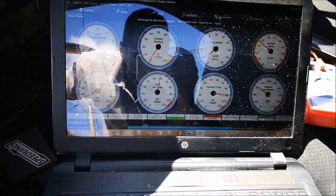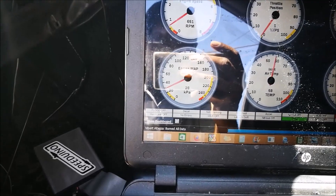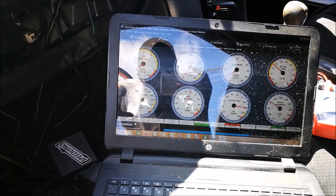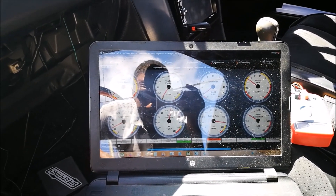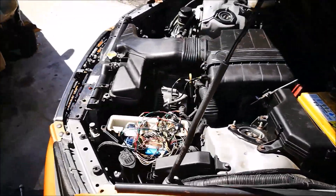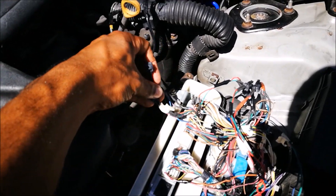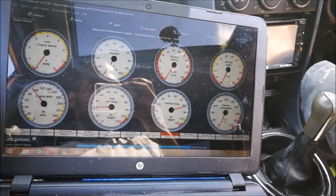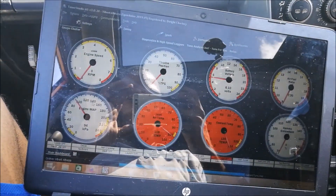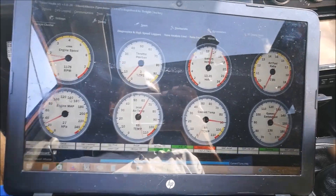With the trigger set, we have minor idle tuning to do — AFR around 12.5, pulling more vacuum than the factory ECU, idling about 600 RPM. We're going to adjust the throttle body to bring idle RPM up a bit and then take it out on the road. It's idling really smooth — really good. Factory ECU disconnected. We're about to take the car out on its maiden voyage to get some fuel and do some initial street tuning.